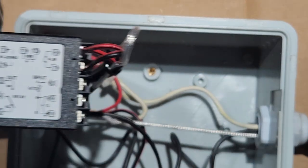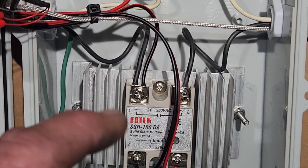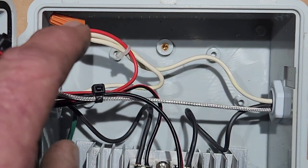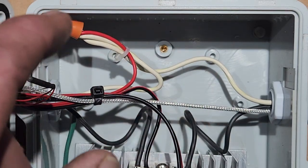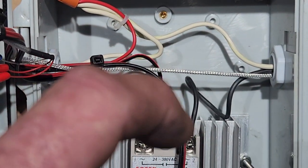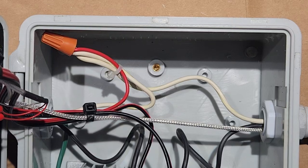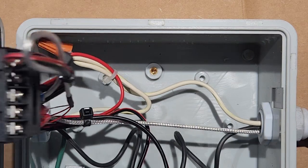Inside the box there are various connections. The easiest way is to unhook the wires — on a 110-volt unit, undo the wire nut. The black and white wires go to the element; unhook one and that disconnects power. On a 220-volt unit, unhook the two wires accordingly. Take a picture first so you know exactly where everything goes. Once unhooked, it's safe to turn the controller on — otherwise powering it on with the element not submerged in liquid will pop the element.